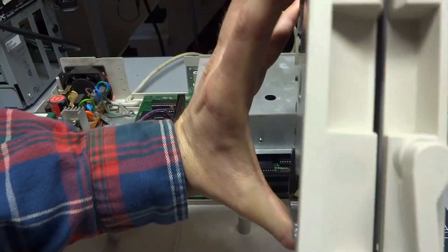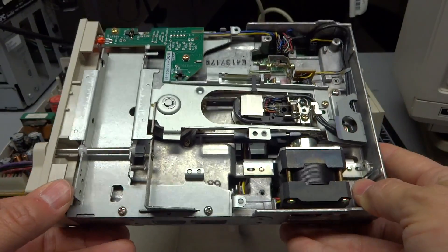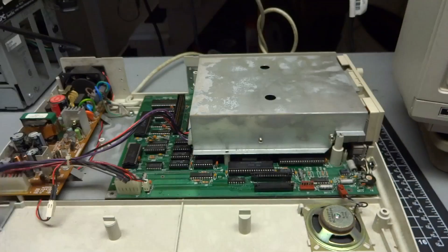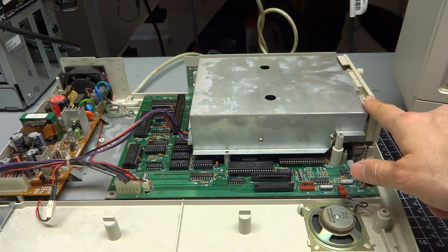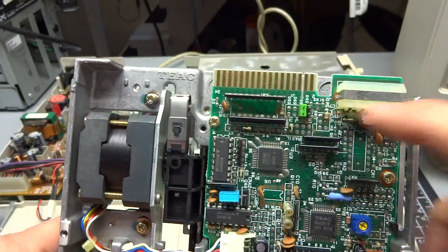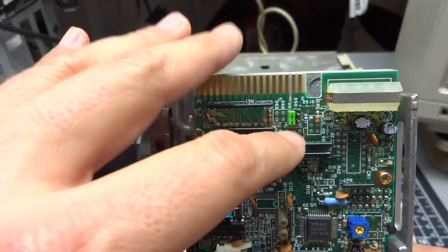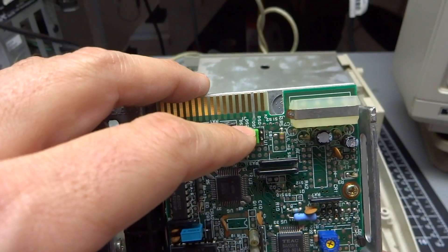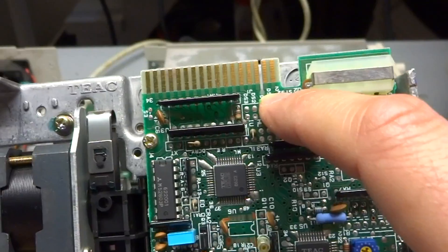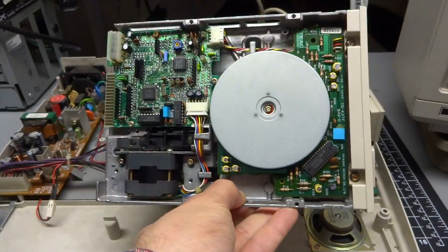People were telling me that Tandy floppy drives are not compatible with regular PC floppy drives. This computer came with two external drives, and I've disassembled all of them. The internal drive is fully compatible with standard PC, so if your floppy drive is bad, you can absolutely take one of these and put it in as the internal drive — but there's something you have to do. If we look at the bottom of the drive on the controller board, there are some jumpers. On the 360Ks, all of them look the same — you have two jumpers labeled DS1 and DS0. To put this drive inside the internal bay, the jumper has to be in the DS0 position. On the DS1 position, I presume this works in the external chassis. But if I plug this into my standard PC, this drive works normally plugged into my 286.